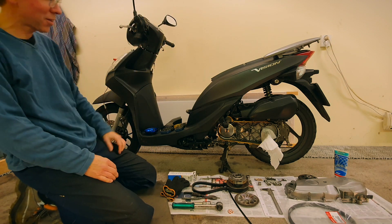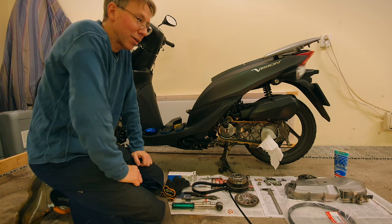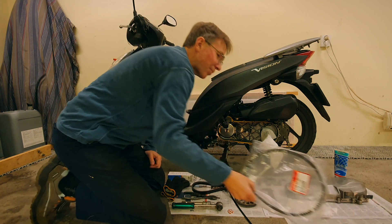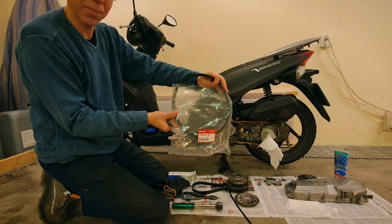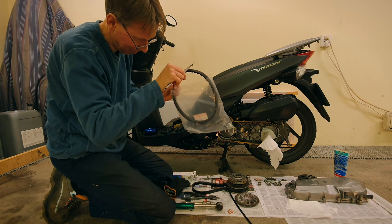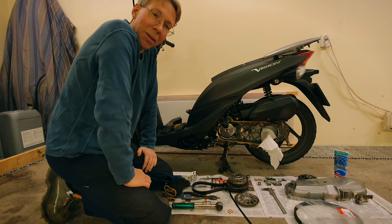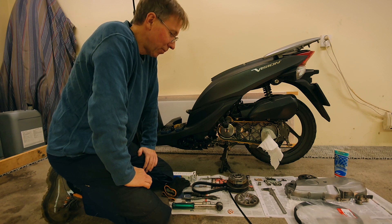It has some small scratches here and there but in general it looks quite decent. I've just found out that she was complaining a bit that it doesn't really make 45 km per hour — it makes 42 km per hour. And one reason could be the belt. I measured the old belt — it's just below 18 mm. I called a Honda mechanic and he said it shouldn't be narrower than 18 mm, so it's due, and I bought a new one.